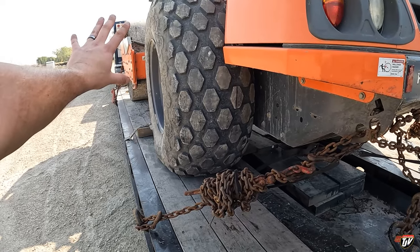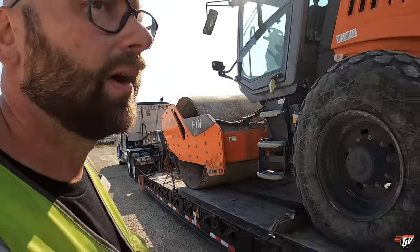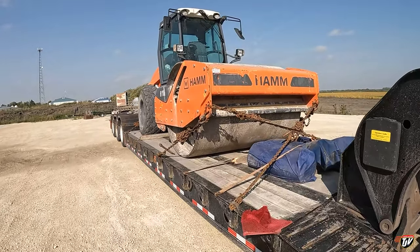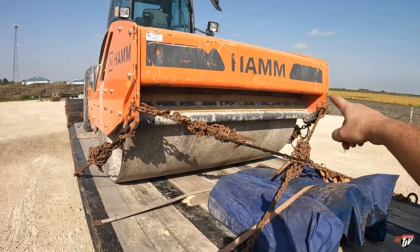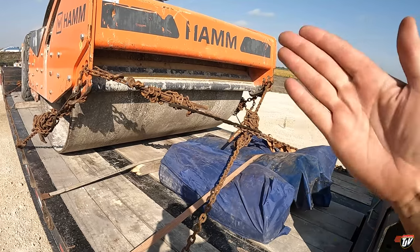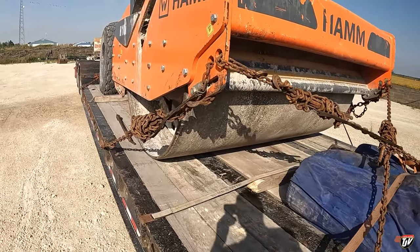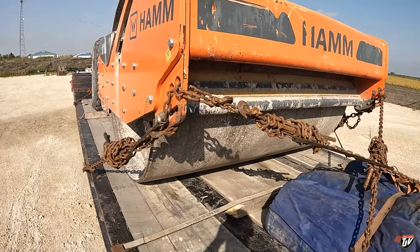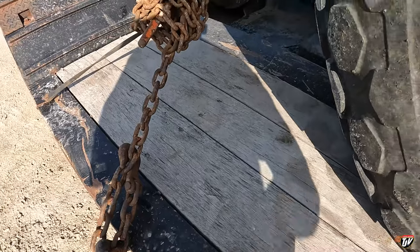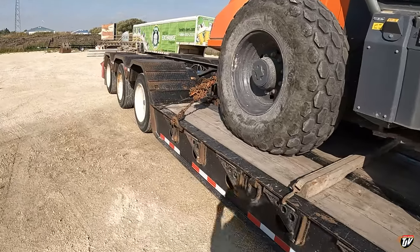These put pressure forward, these are also holding it back. On the other side — same thing at the front. At first I put one chain all the way from the bottom over there through here and down to here, but I switched that up — I added another chain, one from here, one to there, to crisscross it. That holds it from going side to side as well as holds it from going back. And if I hit the brakes, these chains here hold it from moving forward, as well as that one on the back I had crisscrossed.